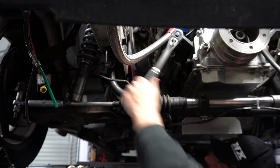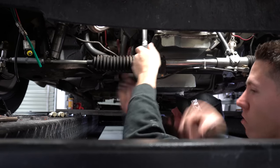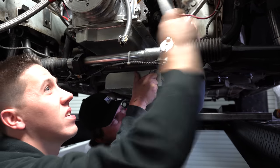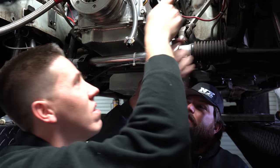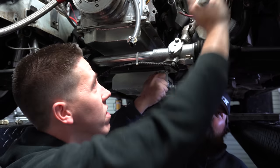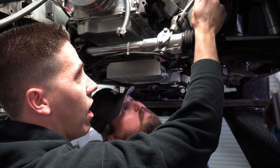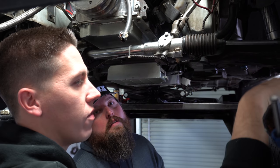We're going to go ahead and get the motor mounts loosened up while we're down here. Pretty much just that one little bolt at the top of the tranny — verify I can reach down from the top and make sure it's completely loose. This thing is dirty — the car is like 150 or 160 thousand mile chassis. All this alcohol system and methanol kit will come out. That hot wire off the alternator was just dangling — I was laying in bed and freaked out, but it has the master shut-off in the back of the car.